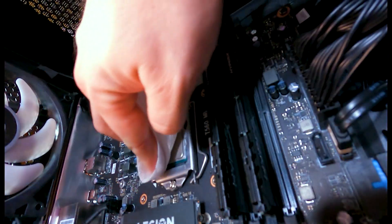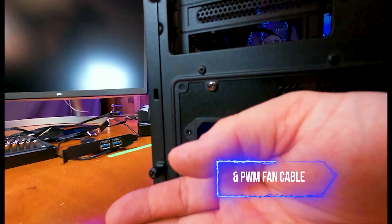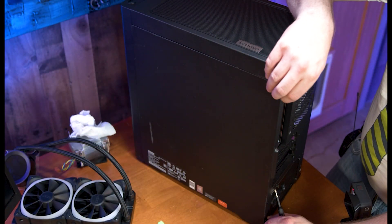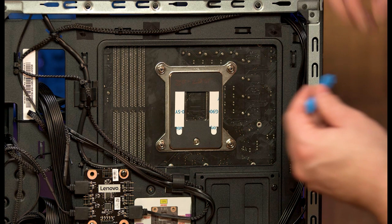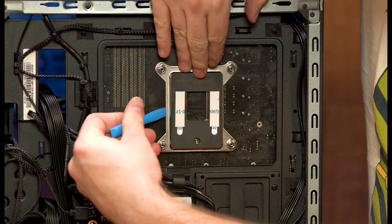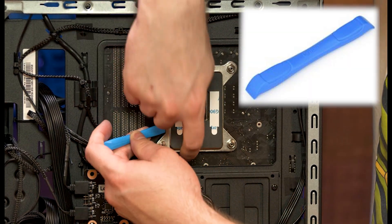We're going to clean our processor off. Removing the heatsink is a pretty simple task — there are four screws you pull out and you're off to the races. Now we're going to take the other side panel off because we need to feed that wire through there, otherwise we don't want all that extra slack sitting in the case. We also need to remove the backplate bracket, which is adhesive — double-sided sticky tape. I have these little blue iFixit pry bars that won't mar up the motherboard and they work great.